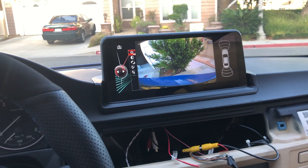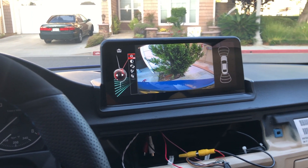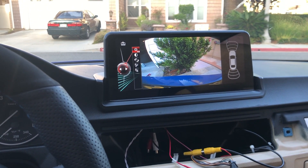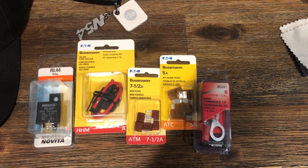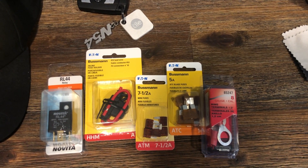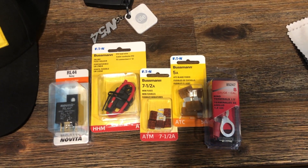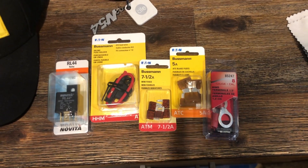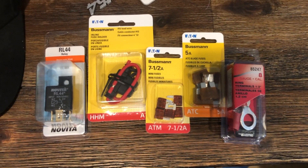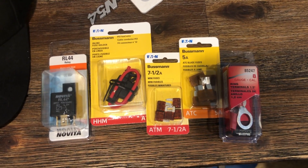I read about this issue once in the comments when I first bought this camera, so I think I need to buy something to clean up the signal. The problem is that the power to the reverse lights drops from about 12 volts to 9 volts the moment you start the car, which explains why I lost that signal whenever the car was on. The solution is getting a relay — you draw power directly from the 12 volts of the battery, and you can either tie into a fuse box and use a fuse there, which protects the battery from any feedback.